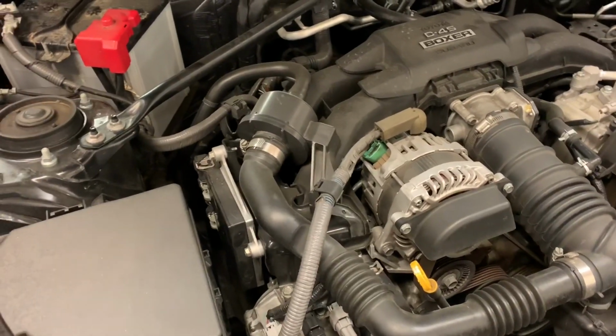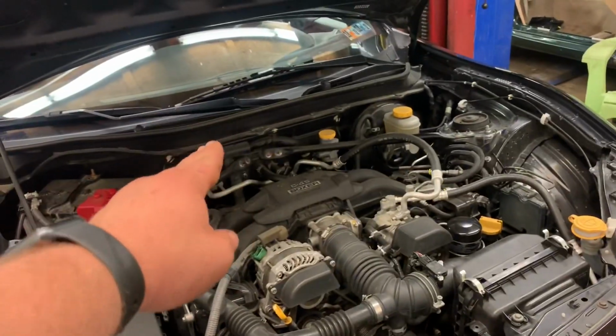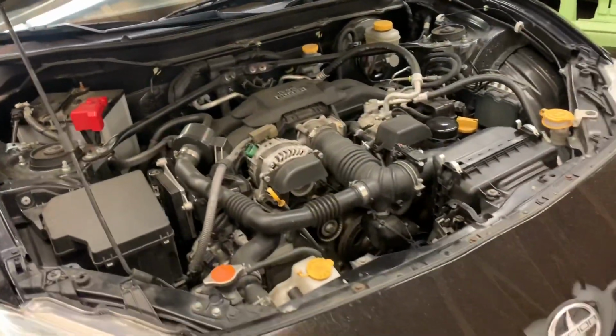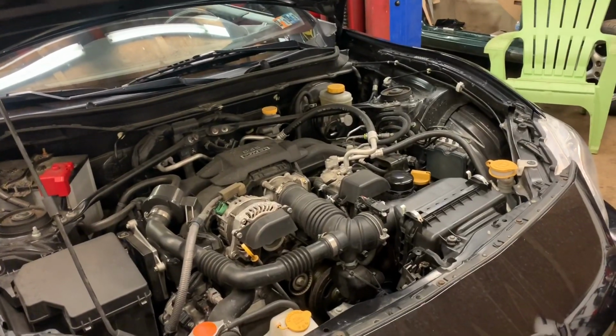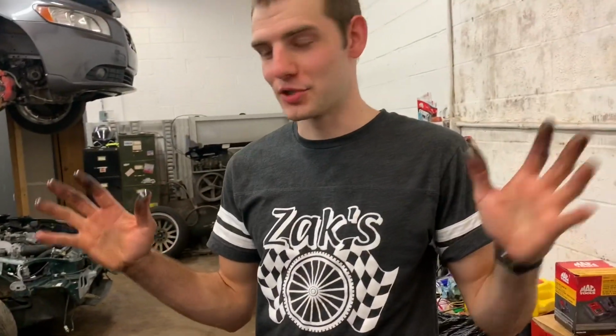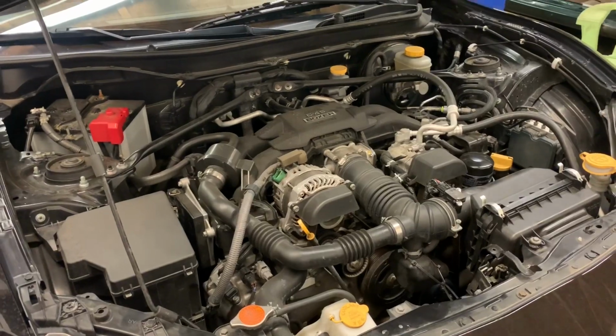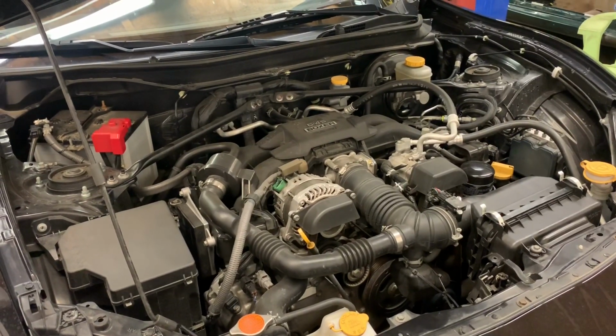He's gone now. So now we're going to put the motor mount bolts back in, the transmission bolts back in, and then we are going to put the belly pan back in. And we'll be done. Actually, you want to start it up real quick? Let's start it first, in case it has a misfire for whatever dumb reason. I'm like a surgeon. Yeah, I'll start it as soon as I know. Start it. Make sure it doesn't misfire before we put all the bolts back in, just so we don't have to take them back out again in case it is.